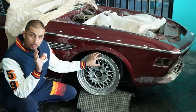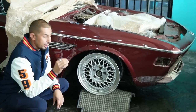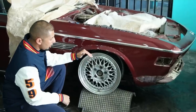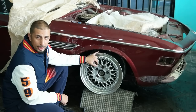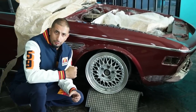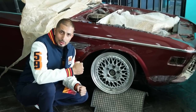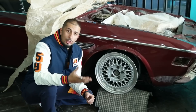Okay, guys, now we come to the stress and the hiccup in the air ride suspension part. There is a lot of space left between the fender and the wheel, and you guys know that wheel gap is a crime. So the problem we sit with is that the strut has been modified. In order to get it to fit, the E30 shock was used and the strut was modified a little bit lower. But that's not enough.